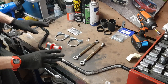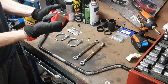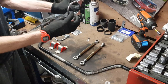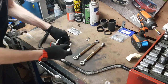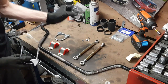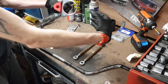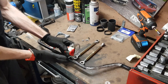To explain how this fits: these are just anti-roll bar bushes — Strongflex polyurethane ones. I've got these on the front anti-roll bar, and some of their gearbox mounts as well, so they're really good. You get a set of those, you get these horseshoe brackets, and what these do is clamp round the back of the rear beam — the beam that runs across the back of the car. These just slide onto the actual anti-roll bar itself with some good old grease — never forget to put that on or it'll squeak like mad. Then this all goes round the back of the beam, and when you tighten the whole lot up, it clamps onto the beam and secures it to the car.